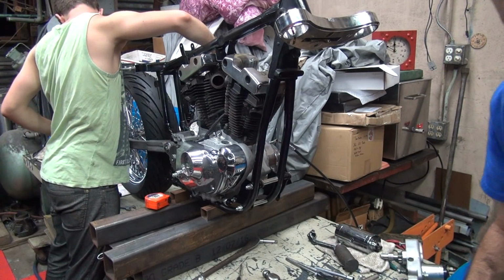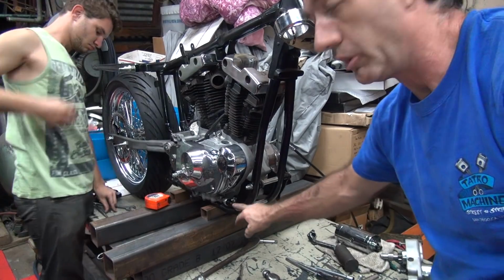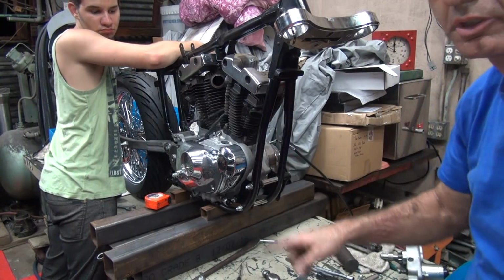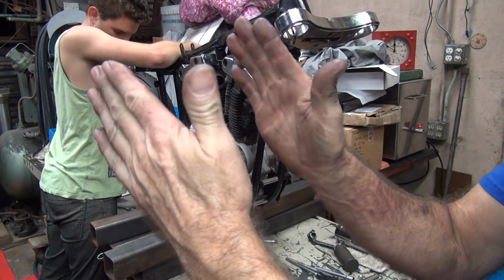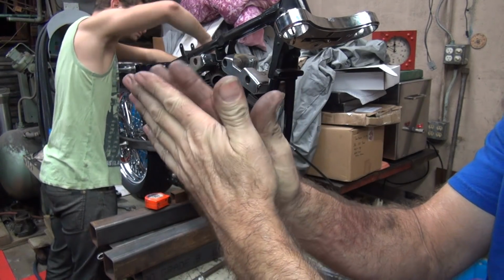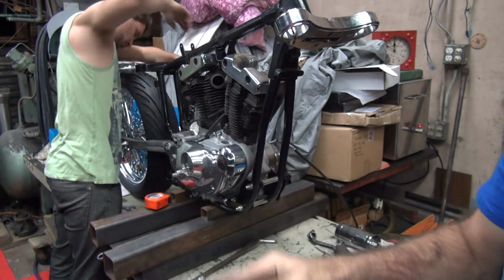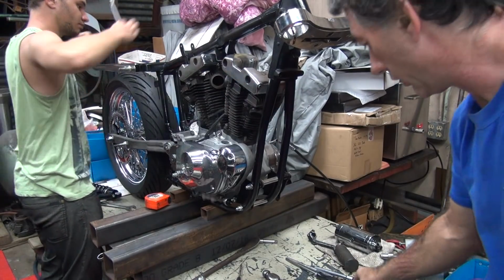Alright, so you can see the procedure I torque them at. Put these two tight first, then you tighten the bottom one, then you tighten the top one, then you tighten the back ones up all the way. They're already pulled in flat, so they're just there with about 5-10 foot-pounds of torque on them at most, about 5 foot-pounds in my case. Then you pull them tight, and the load's off the motor right when you do that.